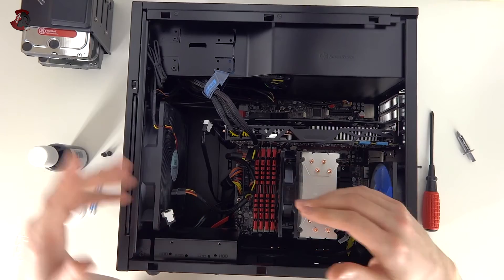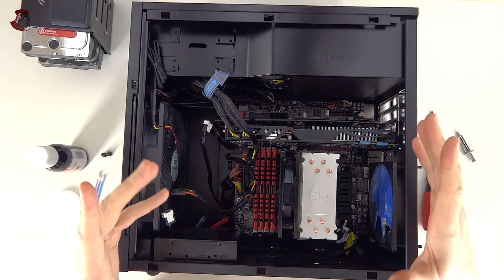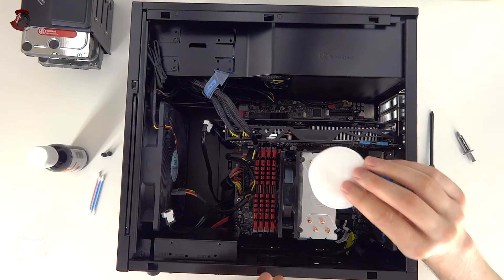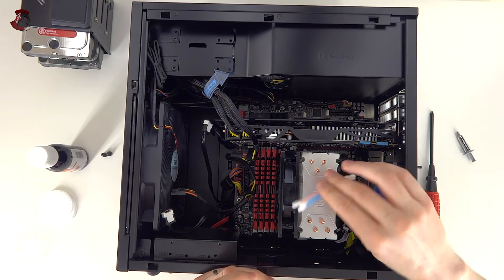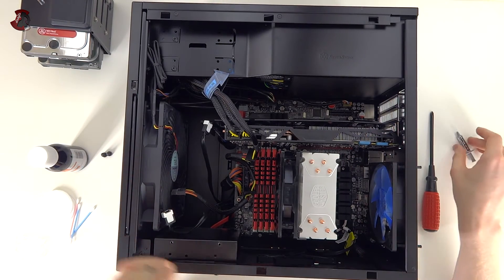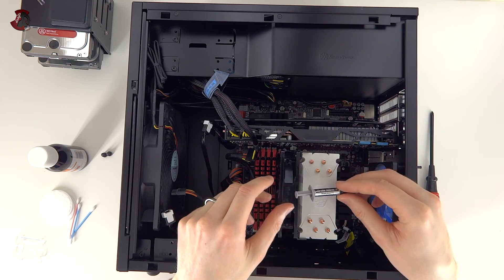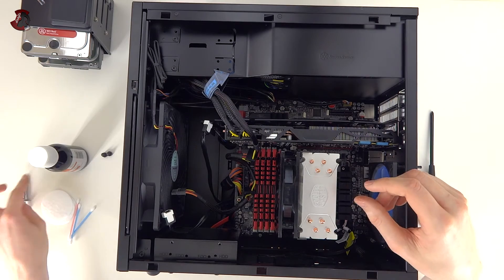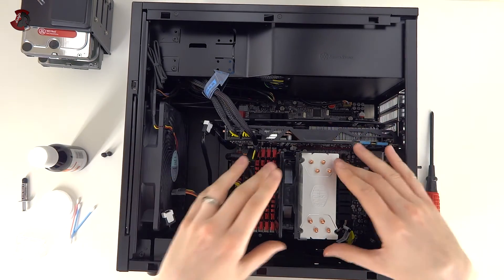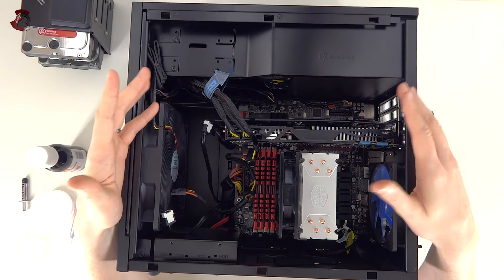That's your cooler reinstalled, CPU reinstalled, and thermal paste reapplied. Next I'm reinstalling my drive cage and putting the case cover back. A couple of things: if you have an Intel stock cooler you can remove it and reapply it to the new CPU. You do need to scrape that old paste off — even without rubbing alcohol you can use cotton buds for more precise cleaning. Thermal paste is relatively cheap — you can get something like Arctic Silver 5 for less than ten dollars or euros and it'll last for several installations. Once everything is installed, check your temperatures — boot into your BIOS and go to temperature monitoring.